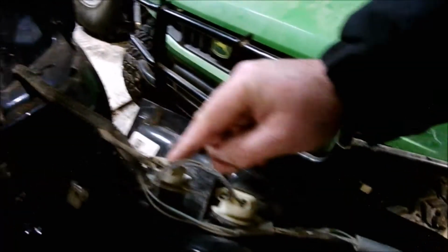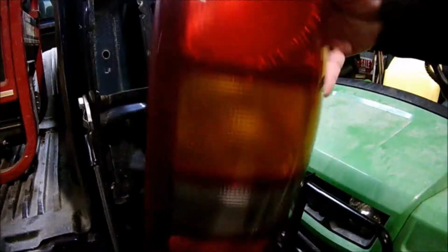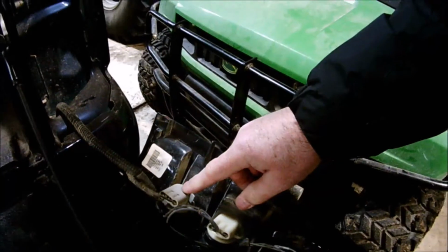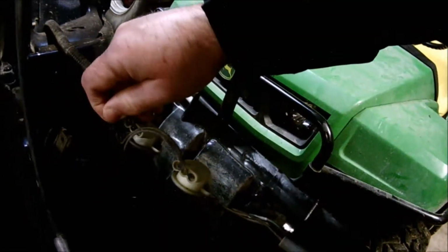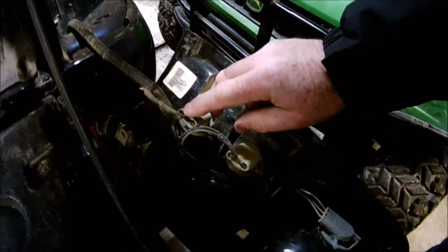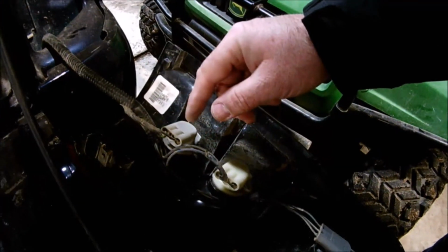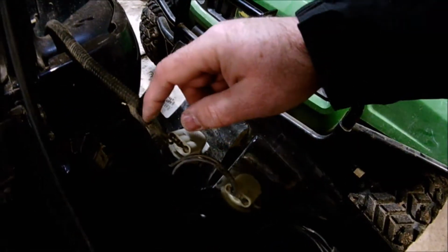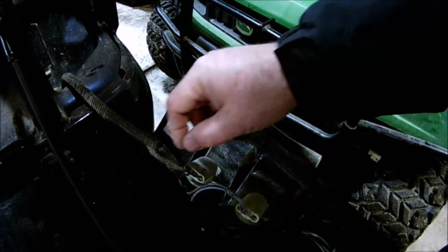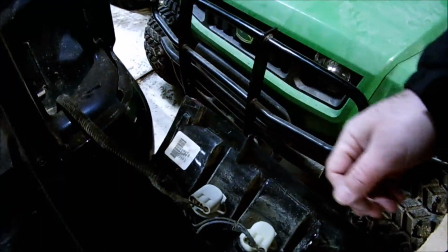You can look right here. This is the backup light. Lower point is the backup light on the 01 Chevrolet. As you can see, I hope you can see, there's a green wire at the lower point, black wire at the upper point. So what I'm going to be doing is peeling this tape back, maybe pulling it out of this harness, and then I'm going to put the other wire, solder it onto these two wires, and go from there.